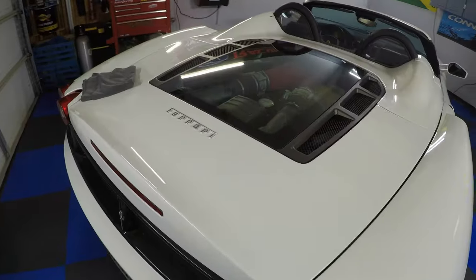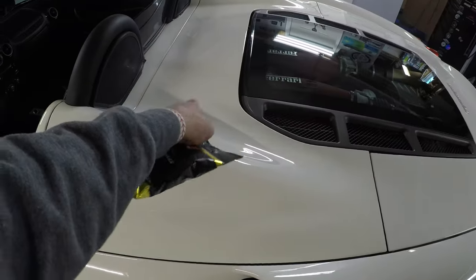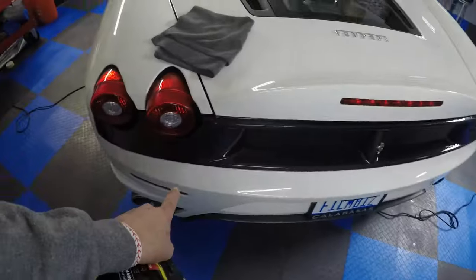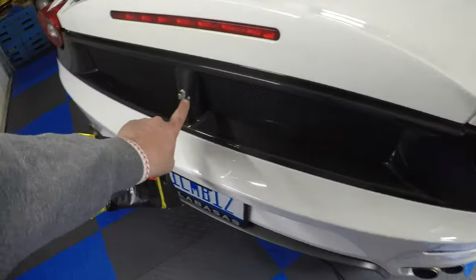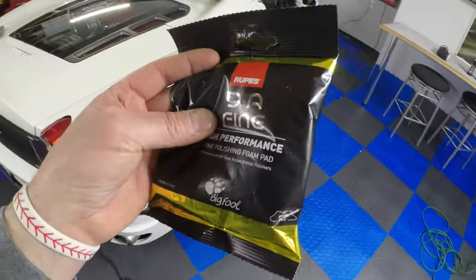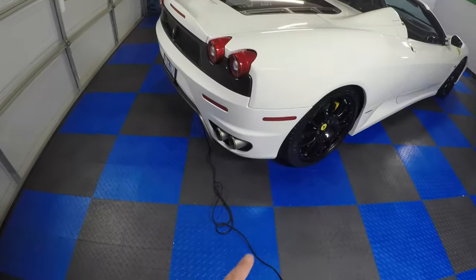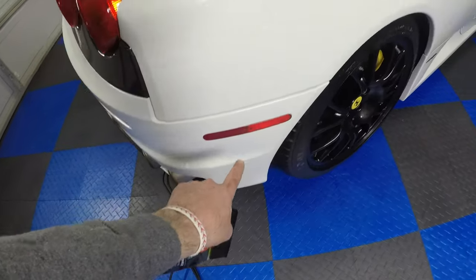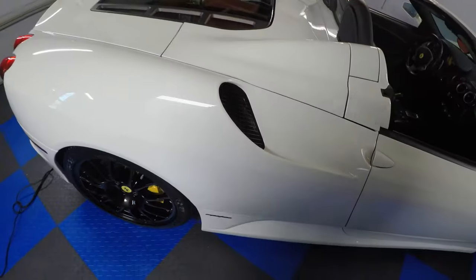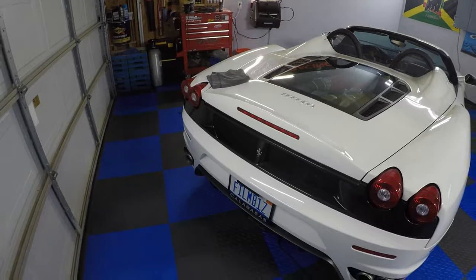All right, that's just the first cut but it's coming out pretty good. I'm missing a lot of the real tight spots, especially up here by the window, by the Ferrari emblem on the back, and all this carbon back here with real tight radiuses. I really need a one-inch pad, but I'm gonna go to the littlest I've got — it's a three-inch tapered Rupes pad. The same pad I've been using at six inches, just a smaller one with a taper, so it'll get into all these tighter radiuses and the spots where the six-inch was kind of skipping. Swap out to the little guy and finish off the back of the car.